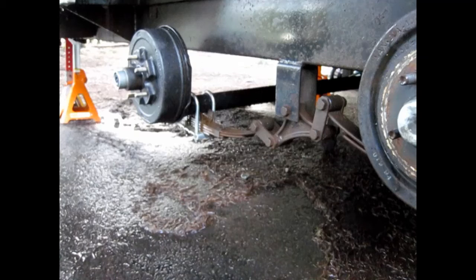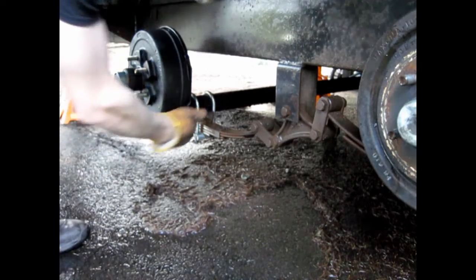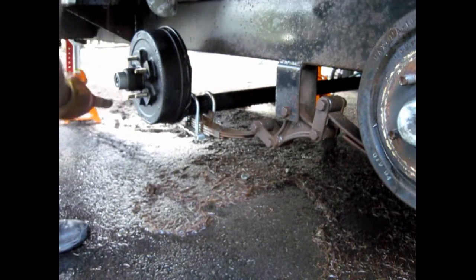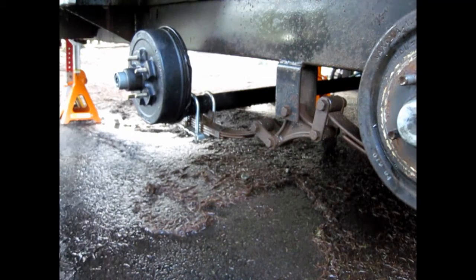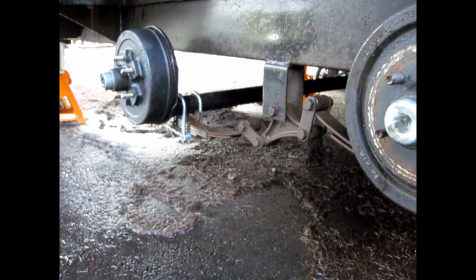Next step: remove all four tires. Now I bought new leaf spring perches — they say you have to do that. They say you can't just flip the axle over. Looking at it now, I see why: the axle is not centered on the hub. The axle is way down here and the hub is way up here, so you definitely can't just flip the axle over. They also say there's an issue with cast or camber, which doesn't make any sense to me, but there's probably a lot of people who know a lot more about this than I do.